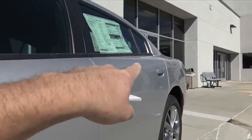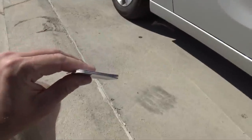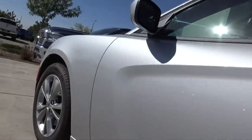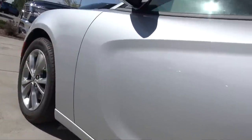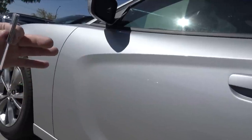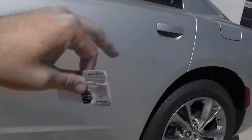That's probably why that back quarter panel line is a little bit far back. So all the way around, it's pretty much 8 business card thickness. The front fender to the door, I think, is like 4. But now I know, so I can adjust these doors forward on mine, and that'll make a lot more sense, because that quarter panel was really tight in the back.